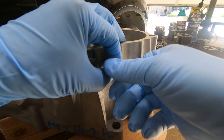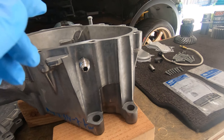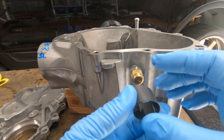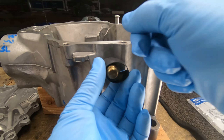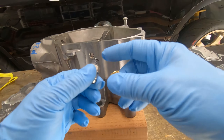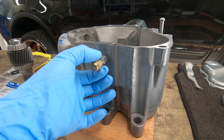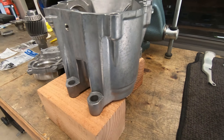What I'm doing here is there is a cap — a cap that seals with an O-ring, and it'll just drain out. Obviously if this cap were to come off it would be a disaster because all the oil would come out, so I'll fix for that. I put some heat shrink on here because it's knurled past the hex. You put it on there and it's not going anywhere. You just slice it off for maintenance and put a new little section of heat shrink on. I'm being overly cautious with this. I have it on the current PTU that's in the car now and I've never had any issues. Once I use this pipe thread that I installed in here, this will always be sealed.